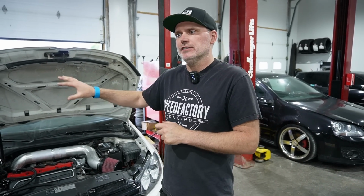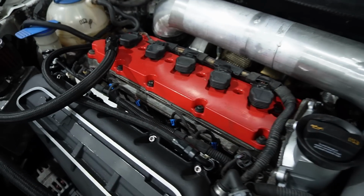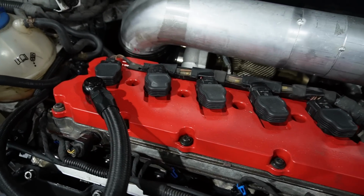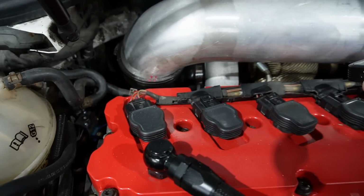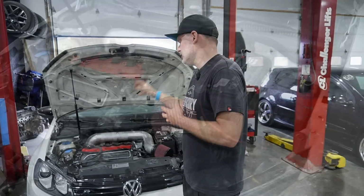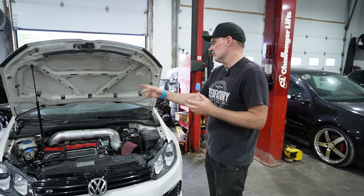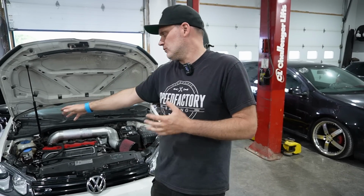Specifically, I've gone down in size to try to get a little bit more spool. I originally was trying to chase a bunch of horsepower with it, but it's a G30-900, and by the sounds of it, it's going to be... Clayton's got a little taste of what it sounds like. You guys probably heard it at the beginning of this video. But we're to the point of just picking away at some small stuff now, the catch can, and get the plate and get the intake welded up, and then it's really time to get it on the dyno and see what this thing can do.